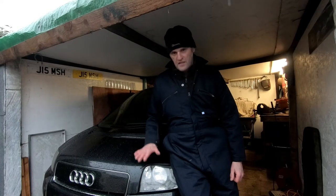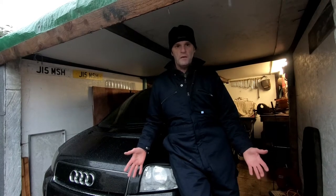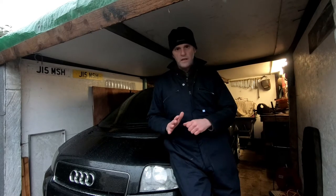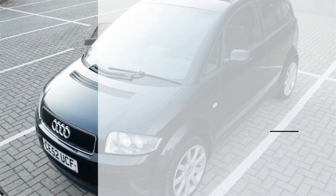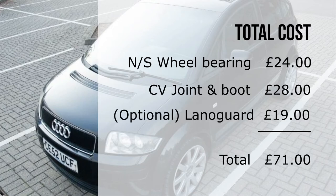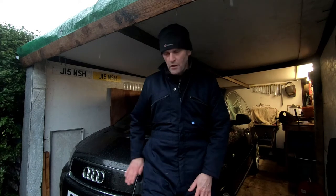Well, I'm pleased to say that was a great success. The car's lovely and quiet again, and by doing it myself I've saved over 250 quid from buying the specialist tool. The worst part of the job was getting the old CV joint out of the hub — it absolutely welded itself in and I had to really hammer it to get out. But the old bearing came out and the new bearing went in really well, so I was really pleased about that. If you've got any questions about this video, please leave them in the comments below. Otherwise, thumbs up, please subscribe — there'll be more A2 videos coming along very soon.